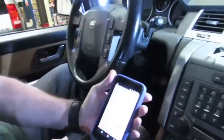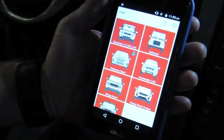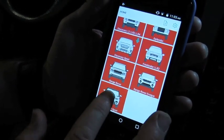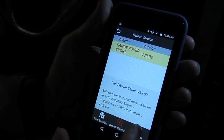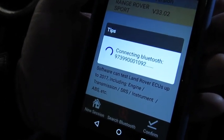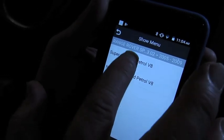So we've plugged in and we're going to pull up our first screen. Just a reminder: the reason ours are all red is because this is the pro version — this has access to all the vehicles. If you have just a single vehicle set up on yours, whether it be an LR3, Sport, or whatever, just that one is going to be set up in red. We are in an '06 Sport, so we're going to go Range Rover Sport and accept all the garage disclaimers. We've got the latest version and we'll hit confirm. Now we'll be connecting to our Bluetooth dongle. We're in a 2006, so we'll select that, and we have a 4.2 supercharged, so we're going to choose that.